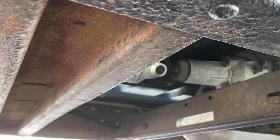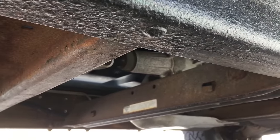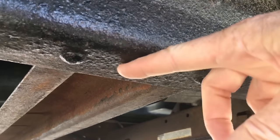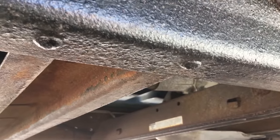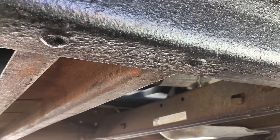While the body is galvanized and protected from rust — you can see the body is looking pretty good — the frame is still going to rust. The good news is it's made out of pretty thick stuff, and I've painted over some of it with rust primer to slow it down. But you definitely want to check for frame rust and get under it and paint it if you buy an old one of these, just to make it last a few more years.